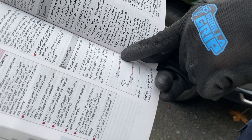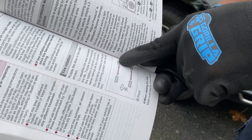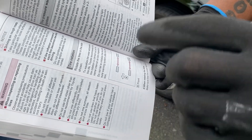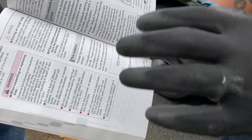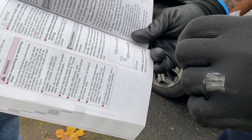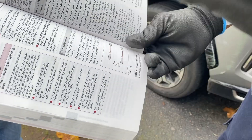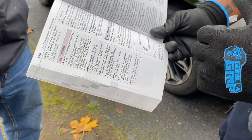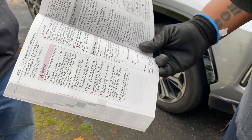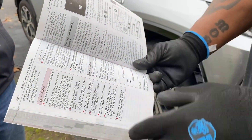The X pattern tells you to take the right rear and move it to the left front, and so forth. Now, if you have a setup where your tires are staggered and directional, you've got to go to a tire shop, have them take the tires off the rim and remount them so that they're rotated. But this car is different — he doesn't have a staggered setup and his tires are not directional.